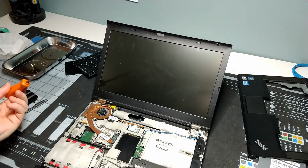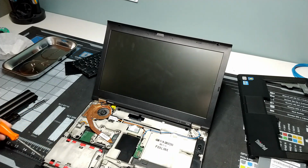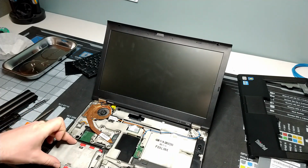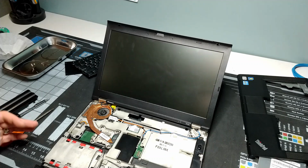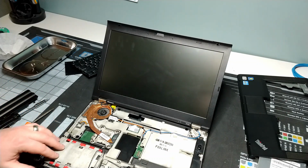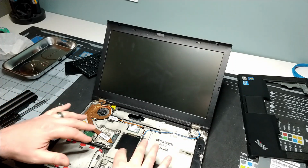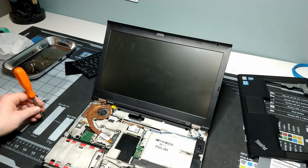I will note here, I didn't remove it for showing, but this area where you see these red marks is the cushioning for the hard disk drive, which goes in this area here. This model, because I mentioned it was refurbished, happens to have a Lite-On 120 or so gigabyte SSD drive installed, and then there's 8 gig of RAM with two 4 gig DIMMs in here as well.